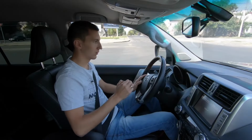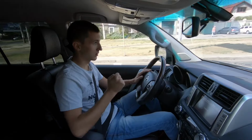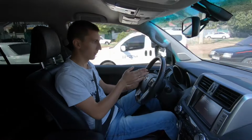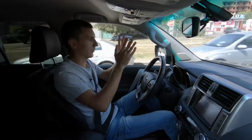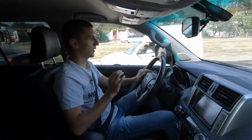But there is a downside. The downside is the stiffness. The vehicles have become significantly stiffer with the KDSS system. The longitudinal rocking has not changed much. That is, when we encounter such rocking, the vehicle behaves absolutely adequately. I am fine with that.